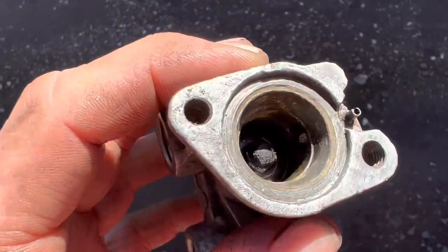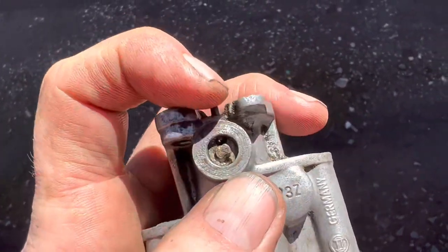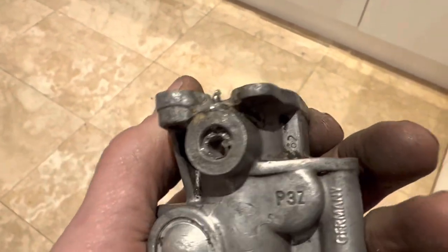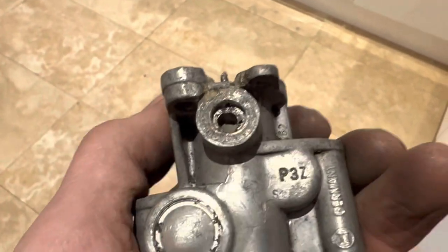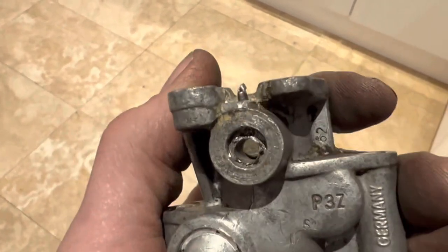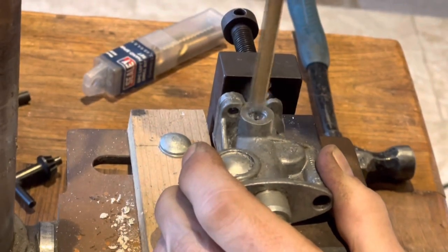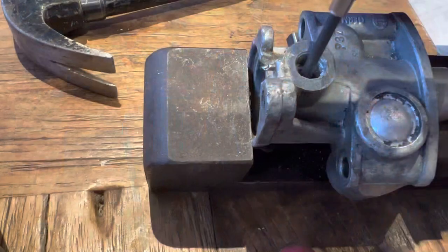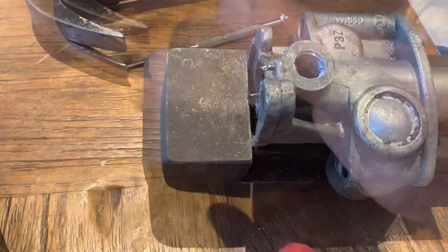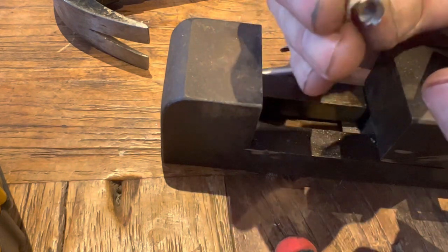In order to get the piston out we would have to drill out that cam bolt and take out this pin. We're up to five millimetres in that hole now and we're getting perilously close to the edge but it's still not budging. I've tried heating it. I'm going to try an easy-out in there and give it a twist, see if the metal is so thin now it'll break. I think we've just about got it — yes, that's it.